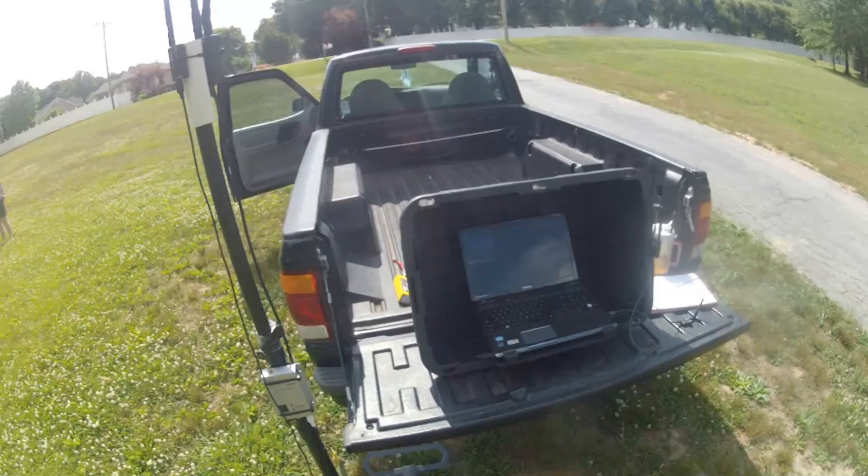So I took off in manual mode, went up a little bit, then went over to the six button on the right which is Land, and touched it. Figured — hey, this doesn't even need GPS, it's purely barometer and flight controller — let's see if it works. The thing started landing and got down near the grass, and I decided I wanted to land on the landing pad instead, so I kind of flopped around a little getting it back onto the pad. It didn't want to respond correctly — I think it was still in landing mode, not paying complete attention to the sticks.